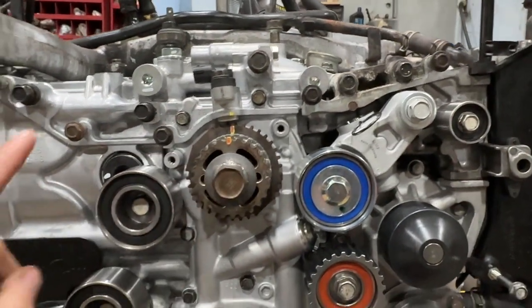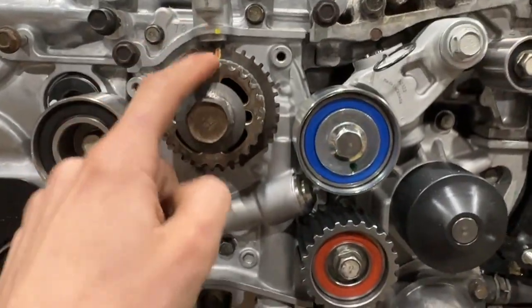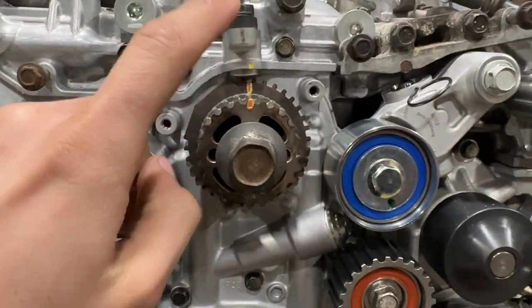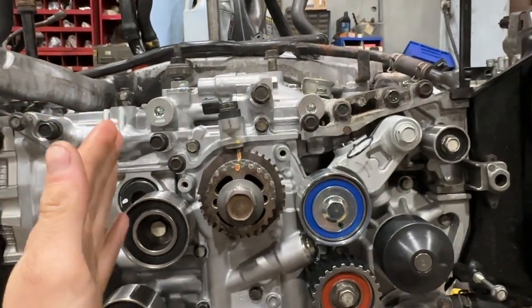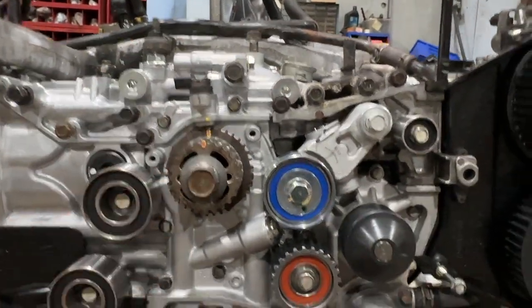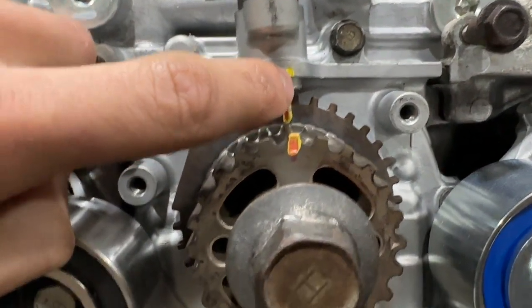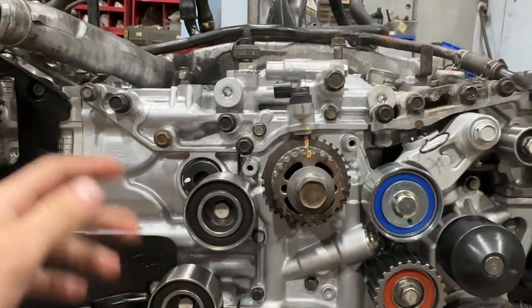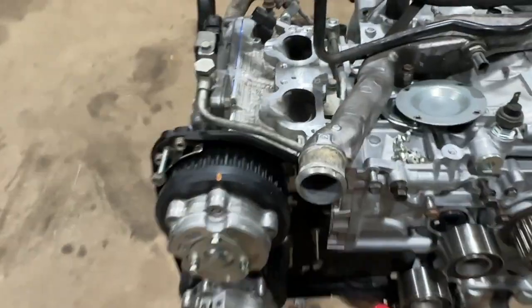This one's already lined up. A little fact: when you line up this mark, most times on other cars you're lining up cylinder number one at top dead center. Subaru does it differently - this mark is actually not top dead center. It's actually when all the pistons are about halfway down on their stroke, which is kind of funny. You're gonna line up this mark down here with the oil pump mark right there, and that puts all the pistons halfway down - not at top dead center like most cars.